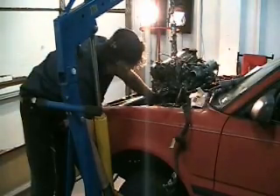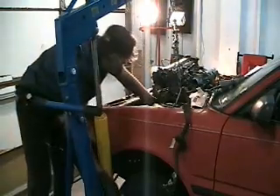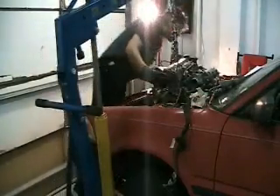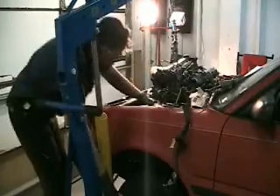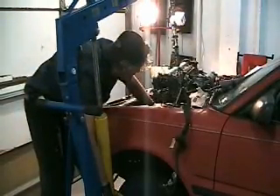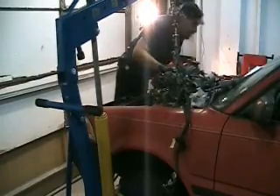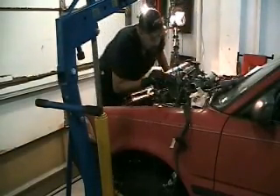Just little movements. And now it's cleared the transmission. This is exactly the same as when we removed the engine — you're just going to go a couple inches at a time, checking to make sure you're not stuck on anything, especially by the firewall because there's a lot of sensors and hoses and also the AC is there. You just don't want to rest the engine on something and lower it because it'll break.